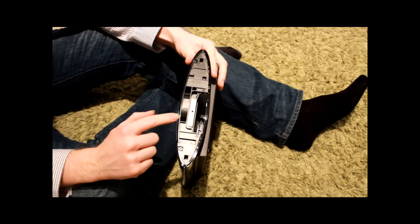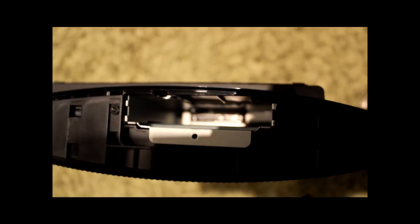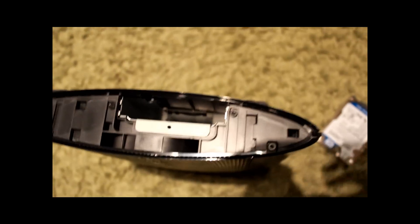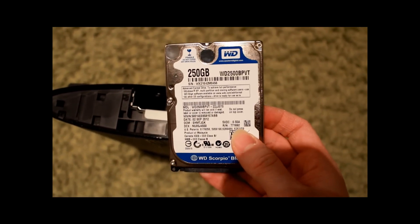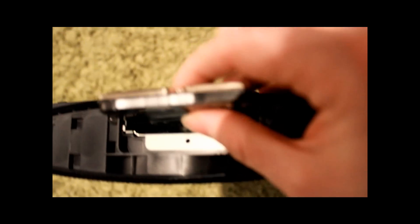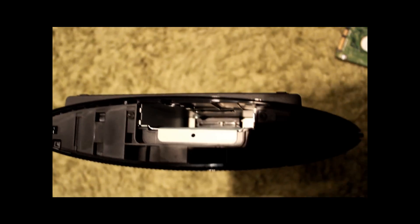So we can see here is the bay — here's a close-up of the disk drive bay. You can just see the connectors inside. This is my Western Digital 250GB hard drive. Remember you need to buy one that is 5400RPM otherwise it won't work. These are the ports on the outside of the drive which match the corresponding holes inside the bay. If you put this inside you can see that it wriggles around a lot — it doesn't exactly fit, and that's why you need to buy the CECH-ZCD1 bay cradle that Sony is selling.